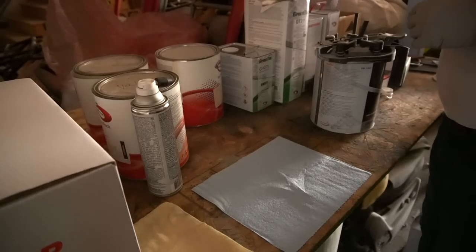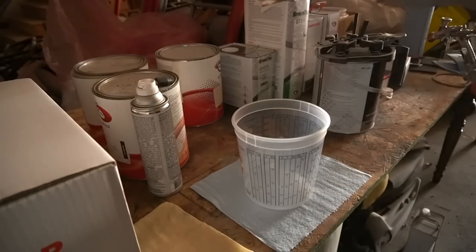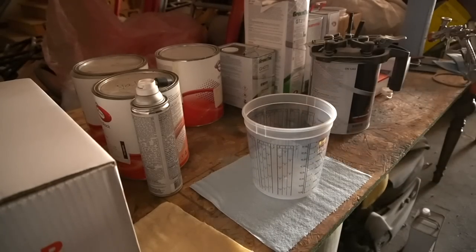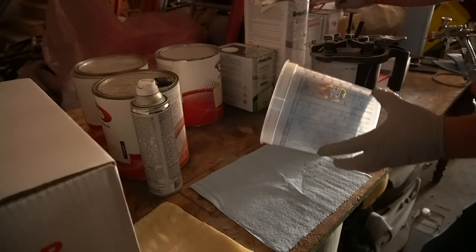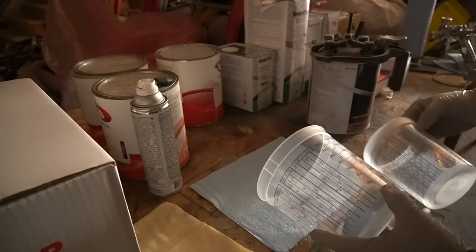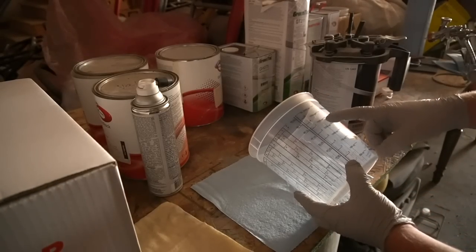Let's premix the sealer. I will turn the GoPro on, put it on my head, and you'll be painting with me. I'm hoping there's not gonna be so much overspray that you can't see it. All right, since I'm painting the full car, I bought the big ones. So let's mix it up. It's a 1-to-1 ratio. How much do I need? Oh man, am I gonna be spraying sealer on the whole car? How many ounces? So I probably need two of this. This is 750 milliliters. So I need one. So 500, 500, and 500.